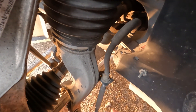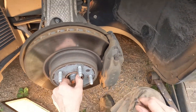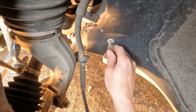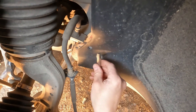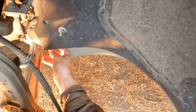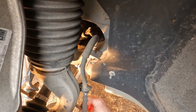Let me see if I can get the camera in here correctly. Bolts, steering bracket, steering. The actual calipers are aluminum. Obviously rusty. So this is all aluminum. Steel nut. The stud, ironically, right here is not — that's aluminum. All the steering lines are steel. The nuts are steel. Suspension lower arms — the bolts that keep everything are steel, but everything else is made out of aluminum.